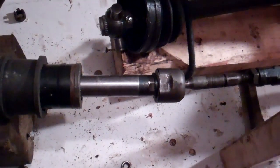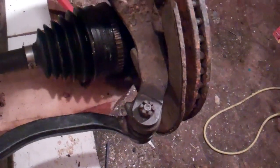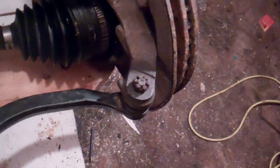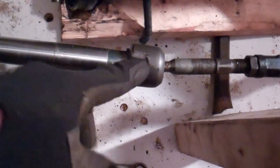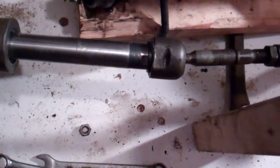I'm going to turn that and move my camera over here. There's the inner steering rod, and we can see the outer tie rod end. I'm still turning that — on the other side, turning our steering wheel — and we can see how that assembly all moves and fits together. Here's our outer tie rod end attached to our steering knuckle. And there's the inner steering rod that we're going to replace.